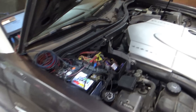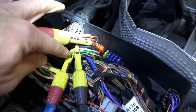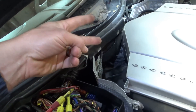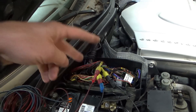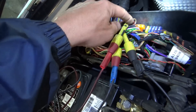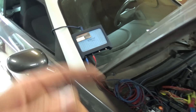Bonus footage: measuring the crankshaft position sensor along with the camshaft position sensor. The green and dark green — or green with white stripe — wires go to the CKP. It's a floating, variable reluctance type sensor. On the Pico scope, since we have isolated grounds, I want to measure across those two wires to get the full amplitude. That's the blue channel. The red channel is on the camshaft position sensor signal, grounded at the battery. Let's open the known-good waveform and shut the car off, then crank it to compare.